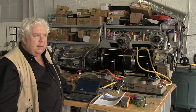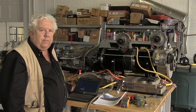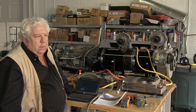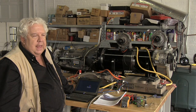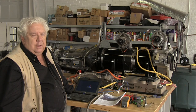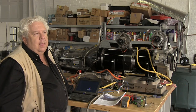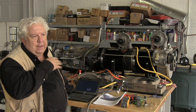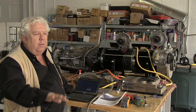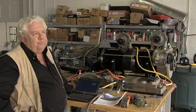For one thing, it's a motorcycle and avoids many of the regulatory issues here in the United States of a vehicle. There is an issue with reverse trikes, and that is that they tend to have all the weight on the back end where the drive wheel is, including the driver, the motor, the transmission, everything. And so the front end gets to be light, and as they go around the corner, they tend to pick up the wheel on the inside of the turn into the air and not be very stable.